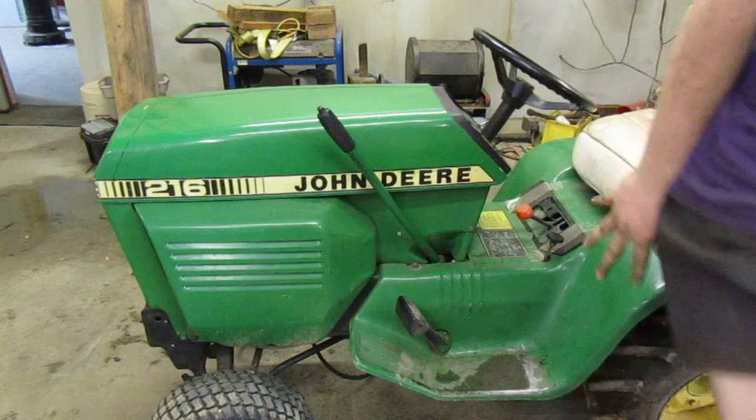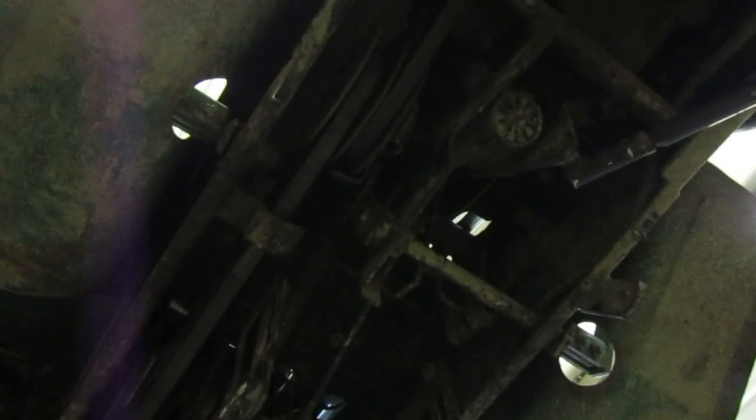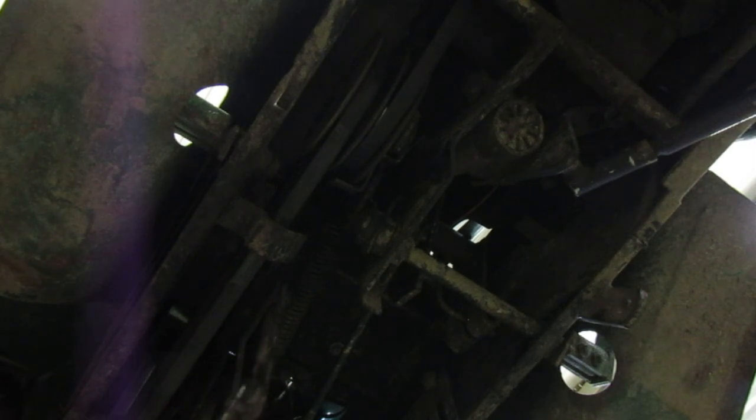And look underneath and see what it looks like. Ready? As you can see, it did what I expected it to. This came in, this came out, as you can see, and this belt is loose. I'm surprised it even turns over with how loose it is. The variator's back all the way and it still drives like that. Yeah, this belt's still just as loose. And this has moved up some. I'm wondering if it's because of this. If since that's spring loaded, it takes a lot of tension off. I'm thinking. I wonder if...